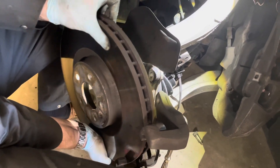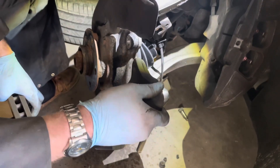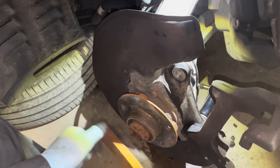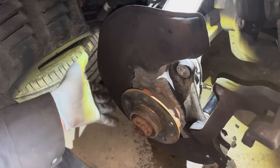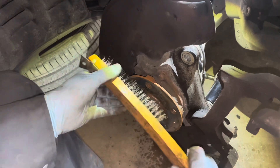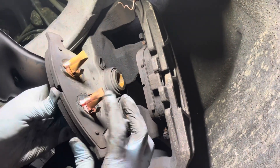In this case I actually didn't remove the entirety of the bottom screw of the bracket — I just kept it loose so I don't have to put the entire thing back on. It's very important to make sure that this mounting plate here is clean, so whenever you remount your wheel and the rotor everything runs concentric, and it'll make it easier to get off next time with no rust. These pads can just pull right out — they're held in with spring clips that go into the two pistons.